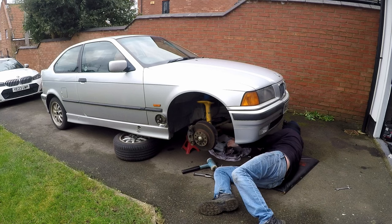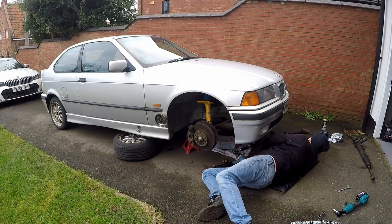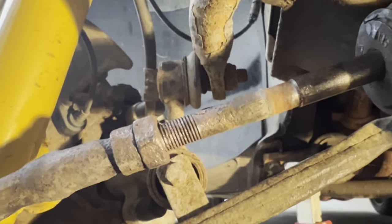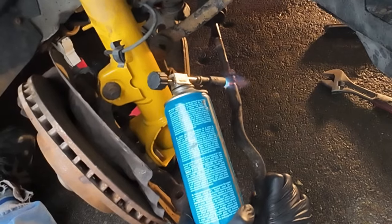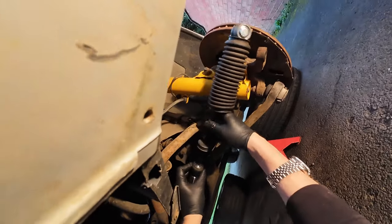The steering rack, like the rear suspension, was a part I'd bought that never made it onto my last car — so do they work? Let's find out. Removing the old rack was simple enough, only complicated by the fact this was probably the first time it had ever been removed — tight and rusted fasteners. The Z3 rack was so old I didn't trust its rod ends, and I couldn't get them off despite spanners, a hammer, foul language, and a blowtorch. So I bit the bullet and bought whole new steering arm assemblies. New parts on a rally car — it's only money.